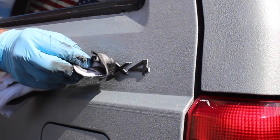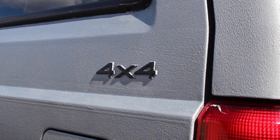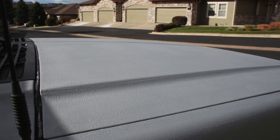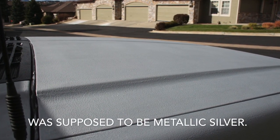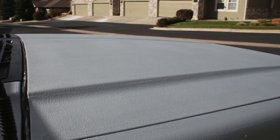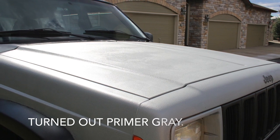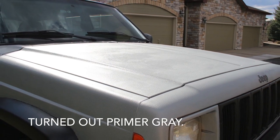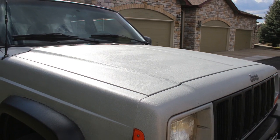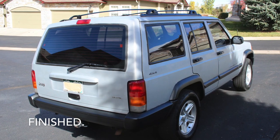In this picture you can also see the bed liner, and below the lettering you can see where I painted over some stripes I didn't bother to remove. This turned out to be kind of a primer gray — the tint was actually bright metallic silver, and this is why I don't recommend using expensive tint to color this stuff; it just doesn't seem to work. You can also see a little variation in shade on top of the hood, which comes from having the last coat get a little tacky as I was putting it on. Another lesson learned.